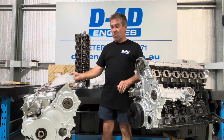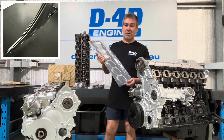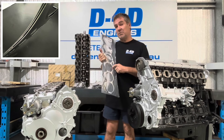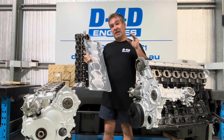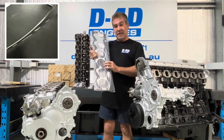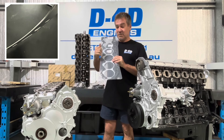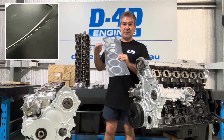The other thing we always use is a genuine Toyota head gasket — this is a must. A lot of the non-genuine gaskets won't have what's defined as an encapsulated core binder in the gasket. These gaskets are multi-layered steel, so you have layers of steel that are joined together. The encapsulated core binder wraps around the firing ring and seals all those layers of steel together.